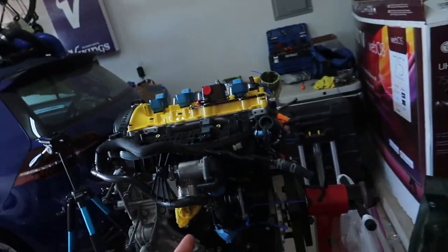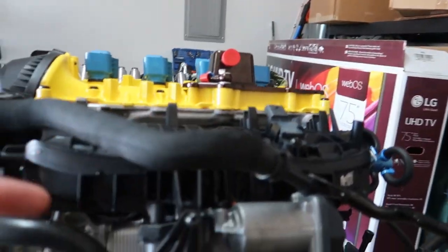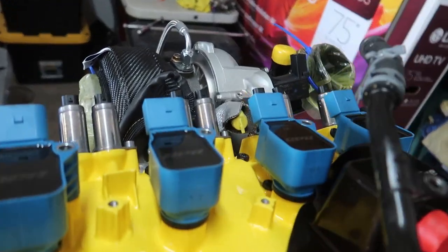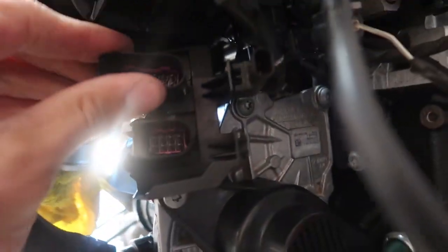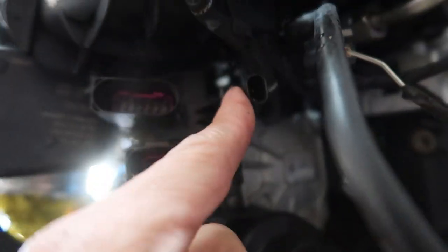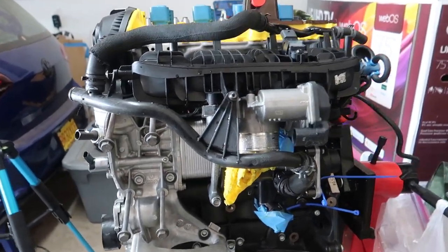Sorry I didn't show that — I got carried away and just started connecting things. So you've got one water hose off of this that goes all the way up, matches here, goes across to that fitting back there which will connect, and I got some nice painted black hardware for that. You've got three connectors that sit under the manifold — one, two, and three. That's for your knock sensor, one that comes around here, one that comes around there. I left this screw in for this line which we'll be getting to.